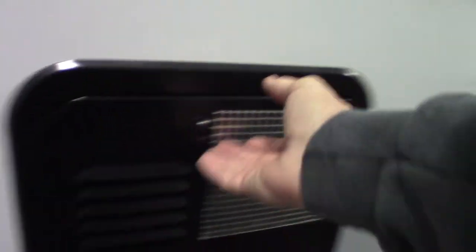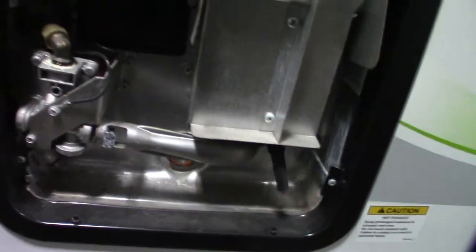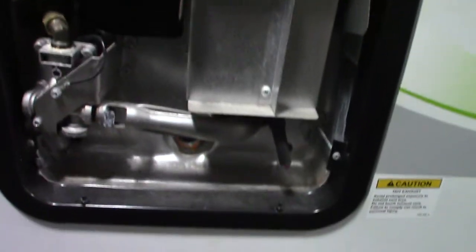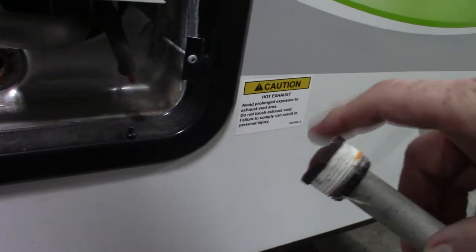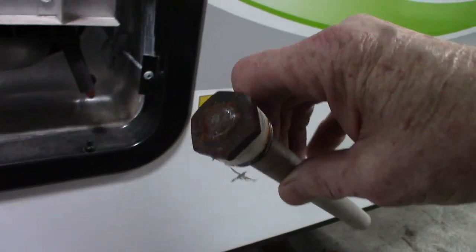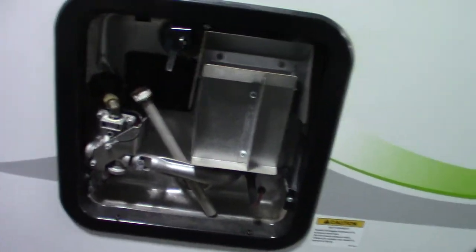These are covers for your refrigerator — they're just inspection covers. Here we have the water heater; it runs on gas. Right now it's drained and the water heater is bypassed because it's winterized — the valves are bypassed in the back of the water heater. This is where you drain it, and this is the drain plug slash anode rod. It's an inch and a sixteenth, six-point socket to screw this in and out. You'll probably need a six-inch extension and a ratchet or breaker bar. The switch to operate this is inside. Never run it without water in the tank.